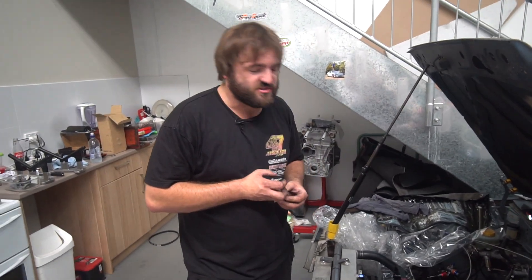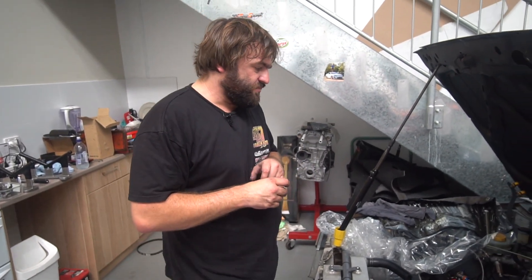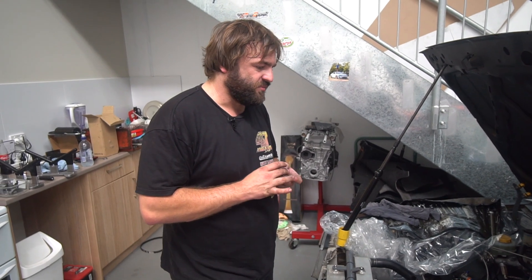The valve springs are limited. On a 16-valve 4A, you can put twin spring kits in and get 90 pounds seated pressure or more, and run about 60 pounds of boost plus — no problem. Whereas on this one, I've run 32 pounds and I think that's sort of going to be the limit.